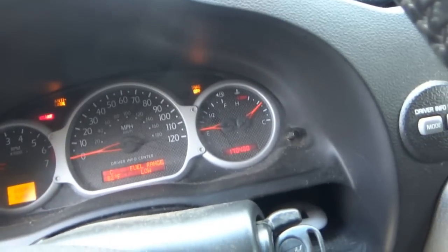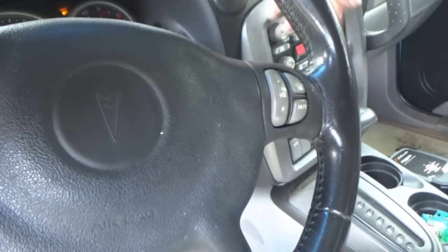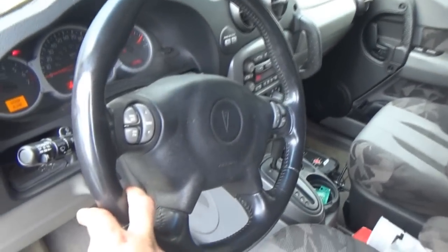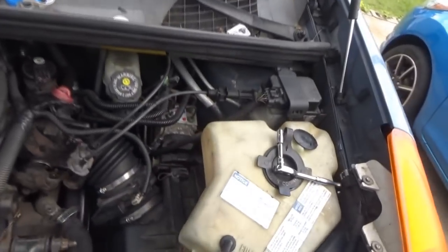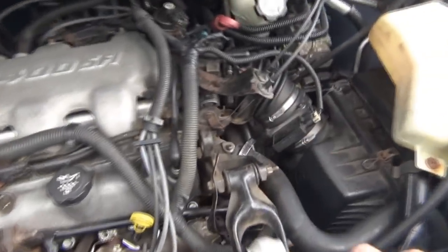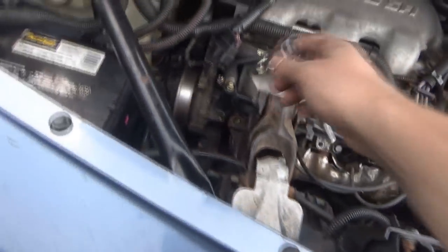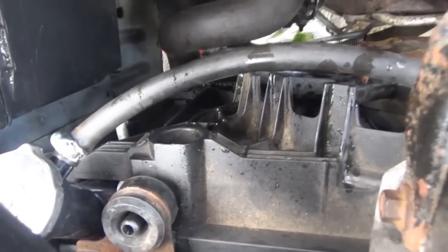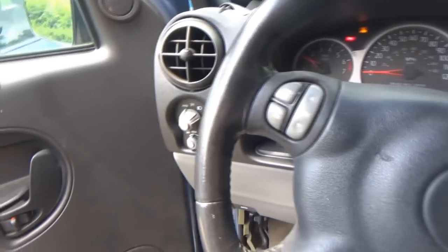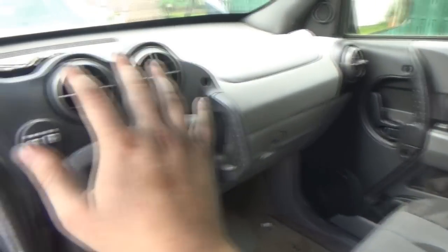She's been running for a little while and the thermostat opened up - so that's good. I'm going to say she doesn't really have heat at this time, so this is probably going to be an ongoing procedure. I just opened up the bleeder on the thermostat and it shot out coolant. This hose is piping hot. I don't see anything leaking and I don't see anything steaming - other than what I spilled. She's getting real good heat now. You can really feel it now. I think we're good.